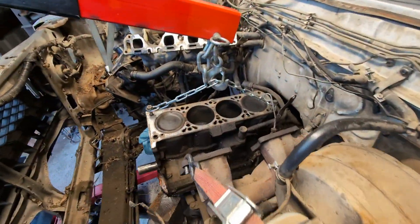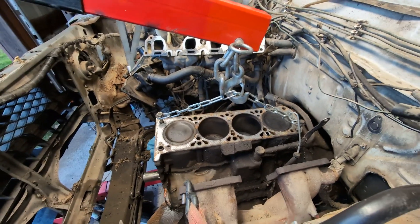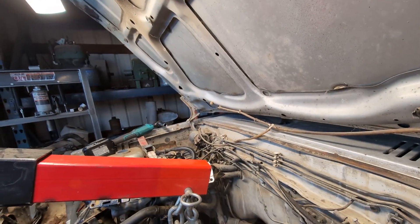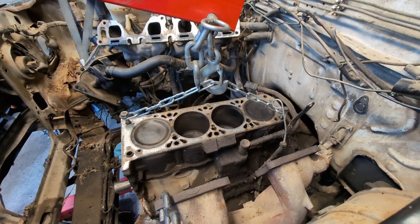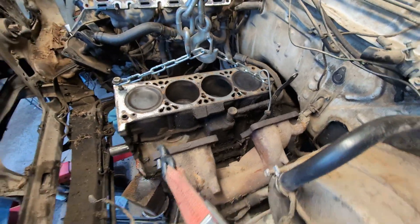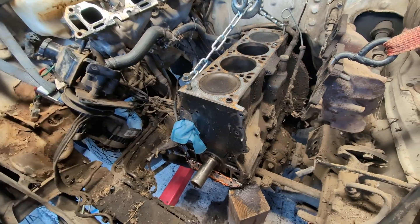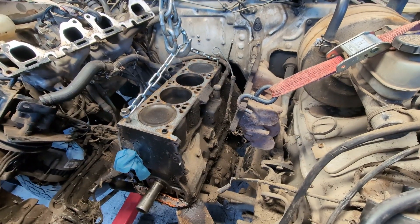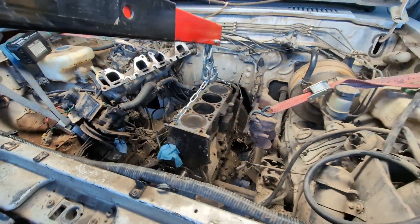I've got a basic chain — it's not super heavy-duty, but again, this is just the engine block and it will be plenty. I'm not taking the hood off because I should be able to fish it right out without having to deal with that, and then I won't have to line the hood back up. There's one bolt left on the back of the bell housing and one underneath. I used an old scissor-type jack from a Lexus LS 400 underneath the transmission to support it so the block won't have any bending load on it. Hopefully this will be out of here in just a few minutes.